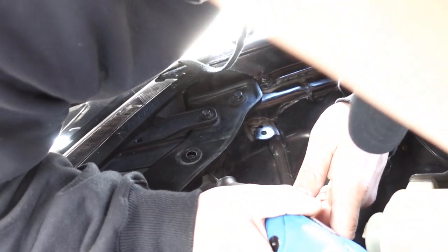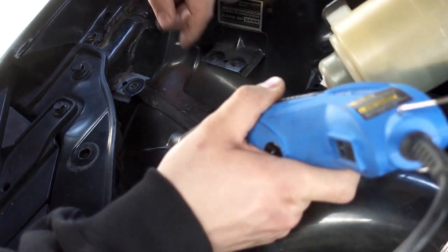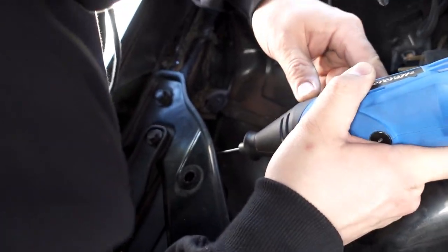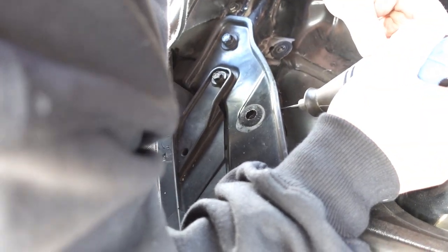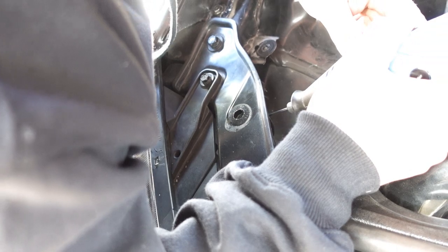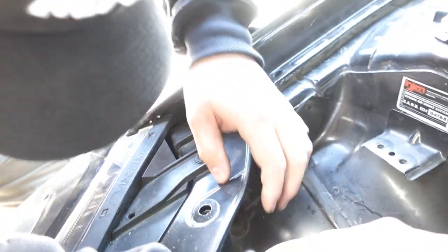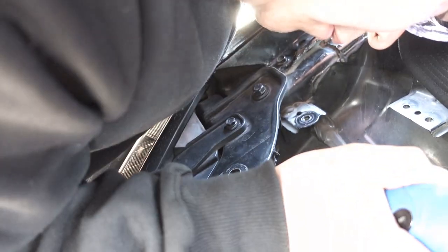So as mentioned earlier in the video, we had those fins that were underneath the opening that we made. Since they're in the way for where we have to put the nut that attaches to the pin that goes up through the Aerocatch latch, we have to cut those fins off. So we used our Dremel tool to cut those fins off so that we can get the nut in there and be able to fasten it properly. And we'll do this on the other side as well.